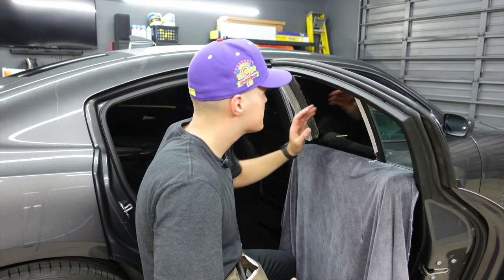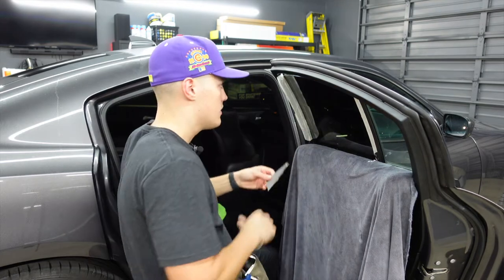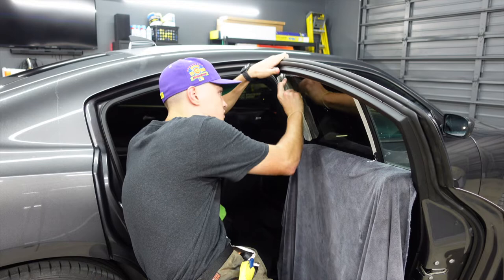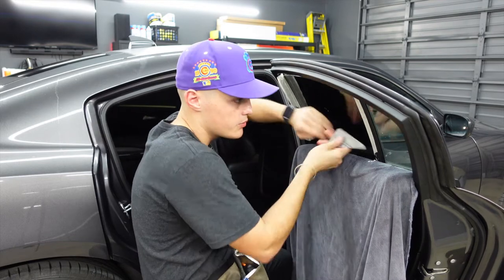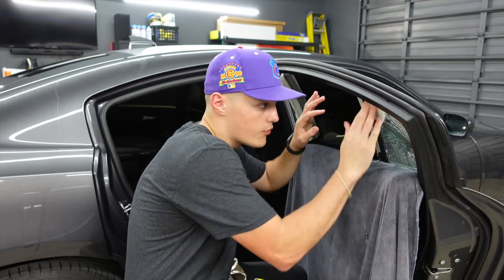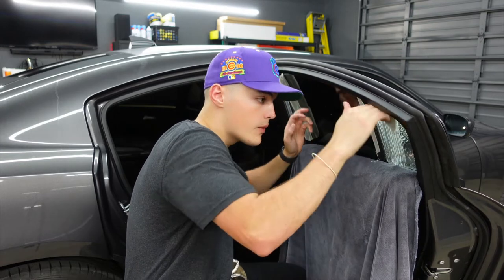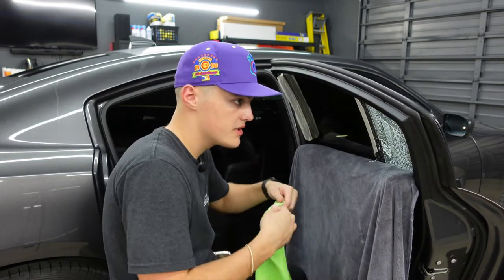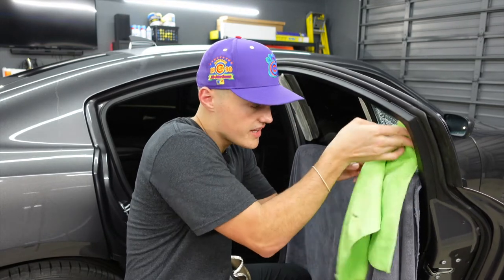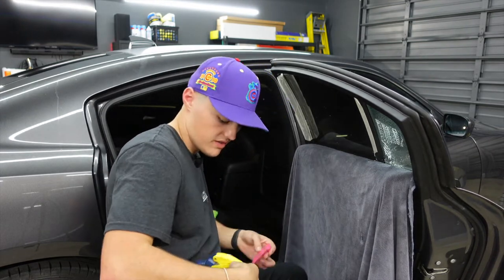My top edge is lined up — it's about as small as it can be. Then I take my squeegee, push out the clean soapy water, take my side swiper, and swipe both edges. We are kind of working on three windows at one time. Before I roll that up, I'm going to go ahead and prep this quarter window the same way we prepped the other one. However, instead of just wiping the top edge on this window, I'm going to wipe the entire thing because dirt collects up in here and will get inside of the window tint — another thing you can do to prevent contamination.